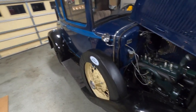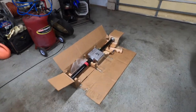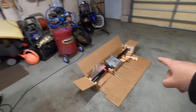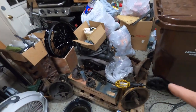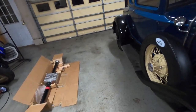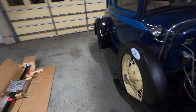What that means is when you shift from second gear into third gear, it no longer bogs — you can actually wind second gear up quite a bit. So with those two things in mind, the question is: is this overdrive going to be worth it? I ordered this back in January, and it was originally supposed to be tied to my original engine, which unfortunately gave up the ghost — the center babbitt decided to go on vacation and has not been seen since.